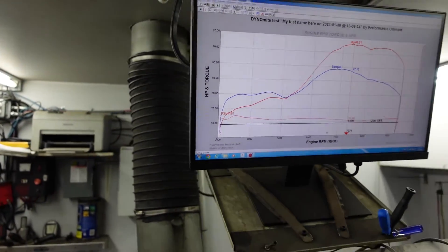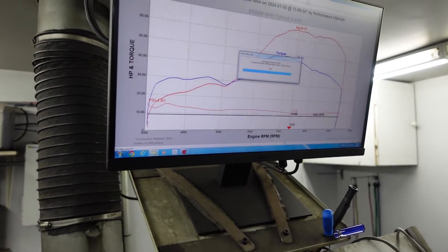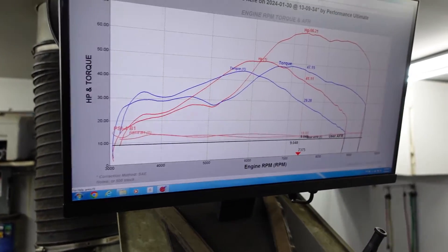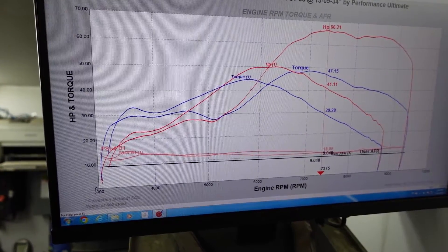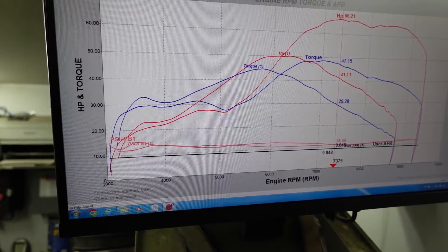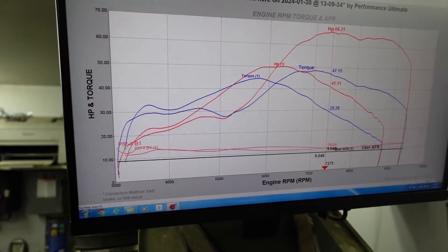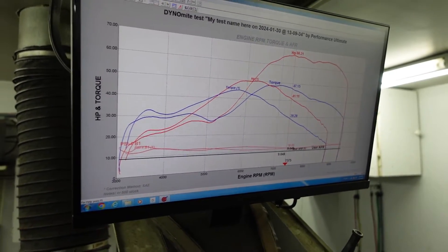I'm a little curious to compare it right here, just to see compared to a stock CR500 — I really want to know what the differences are. Let's add the overlay of the first run we did earlier today. There you see it — pretty much all high RPM. We've lost all that lower torque from the CR500. Obviously the exhaust ports are much higher, bigger porting. So that's kind of what you can expect out of a CR500 — it's probably not fun to run in the low RPM, but it definitely pulls pretty good on the top end.